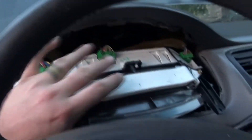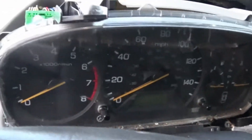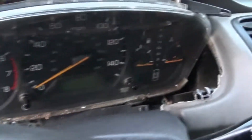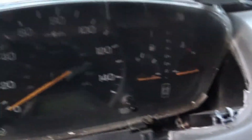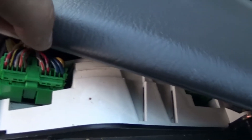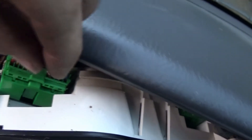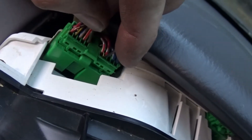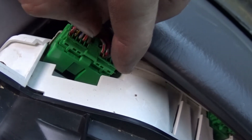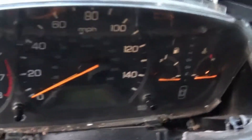I've got the gauges already out, but as you can see here they are. Alright, turn on the headlights — nothing. So what I'm going to do is go up here and take this red and white striped wire and add a wire there, and then add a wire to the end with the red like so. Now I'll turn on the lights and there they are.